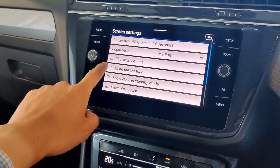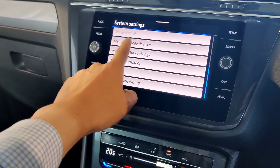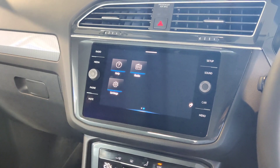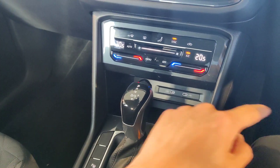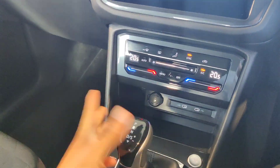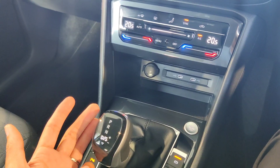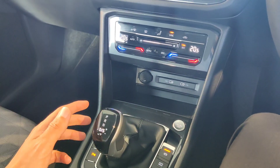That's pretty much how the middle screen works. For the gear selector: hold the brake before changing gears. Currently in Park. Push to Reverse — the reverse camera pops up with parking sensors around the vehicle. Then Neutral, then Drive. To quickly switch to Sport mode, push backwards to S — pull back to Drive, push again for S. Sport mode gives a little more throttle response. Push all the way to Park or pull all the way to Drive. In Manual mode, push right to M and use up and down to change gears.